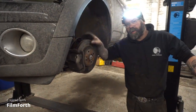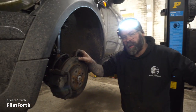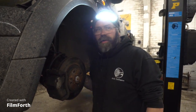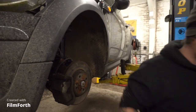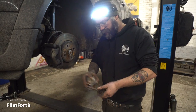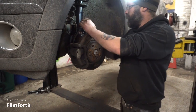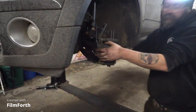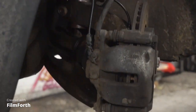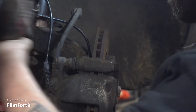If you'll remember, I had to beat the bolt ends pretty hard to get them out, so the ends are probably all manky and horrible. We're going to have to do a bit of a thread repair before we do that because we haven't got any spare ones — it's 8 o'clock at night. With a few minutes on the bench grinder, I've cleaned her off, tidied the threads up, and done a bit of a thread chase. Back on it with the aerosol copper slip, hang the bolt through — look how easy that went in this time. Get the nut on. We're back on the 18s, tightening her up.